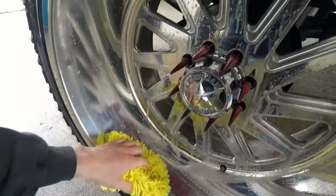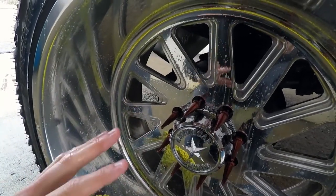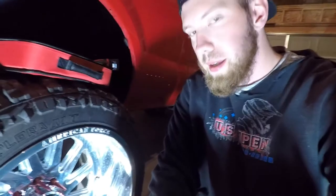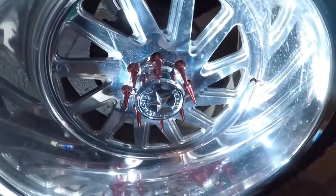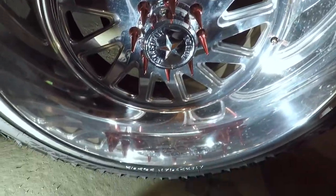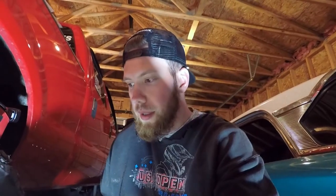You want to continue to go with the grain even though it's annoying to go back and forth on a small piece — that's the way the grain runs. If you go up and down, it shows so much more if there's a scratch versus going side to side with the grain. Also make sure you clean these as well as possible before polishing so you don't grind dirt into the aluminum, which makes scratches worse or forces you to sand the wheel down and repolish.